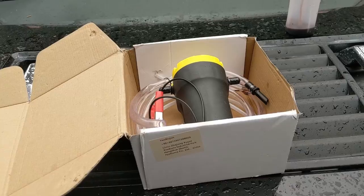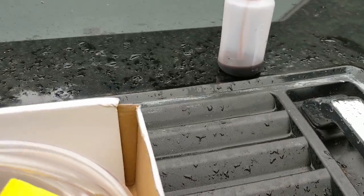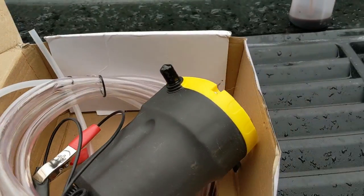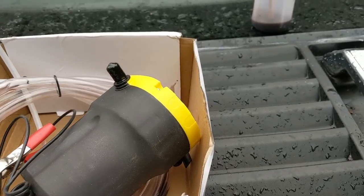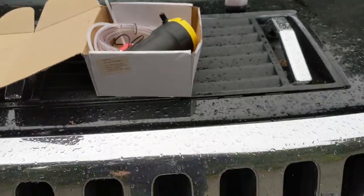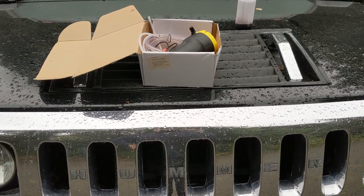To help do this, I've bought a DC pump which was extremely cheap off eBay — probably around 15 to 16 American dollars — and it's very good. It has a pipe that you slide down the dipstick hole so you can suck the fluid out, which makes life easier underneath because then you don't have a pan full of fluid. I'm going to suck the fluid into a container so we know how much is in there, then change the pan for one that has a drain plug, along with the filter and gasket.